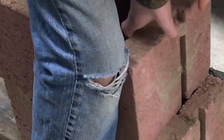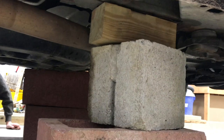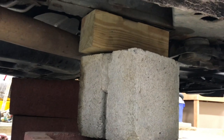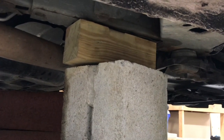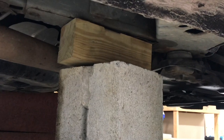It would be nice if we could just take two cinder blocks and put them under, but there's a lot of things to consider. When you stack these blocks up, you want to make sure it feels secure. We have to contact the frame, miss the exhaust, and make sure we avoid the parts we're going to be removing. We're going to be removing a lot of the front suspension.